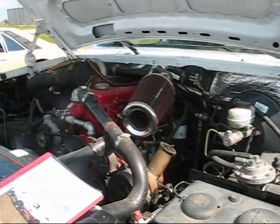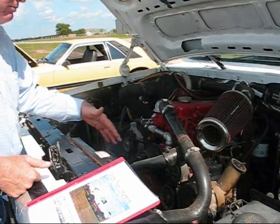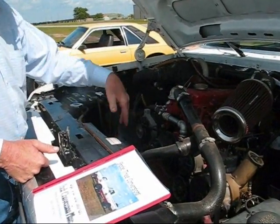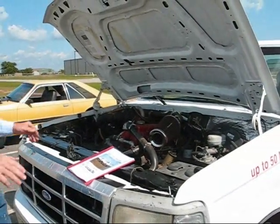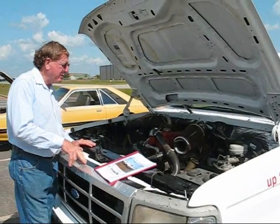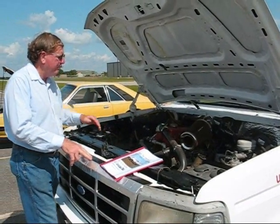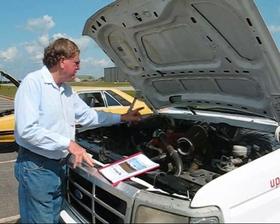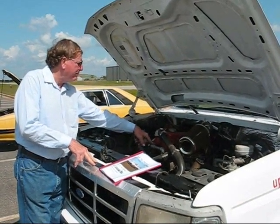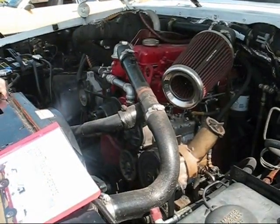We did things under the hood to save belts and pulleys — for instance, we've got a 12-volt thermostat-operated fan to cool the radiator. You don't have to go to large radiators on these trucks; the standard radiators in the vehicles work fine. We've got an exhaust pipe that connects hoses from the tractor engine to the truck, and these pipes are just water pipes to connect the heater system off this engine — I think they came from Lowe's or Home Depot. It's just not that complicated.